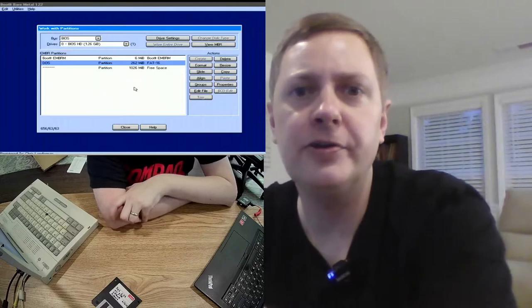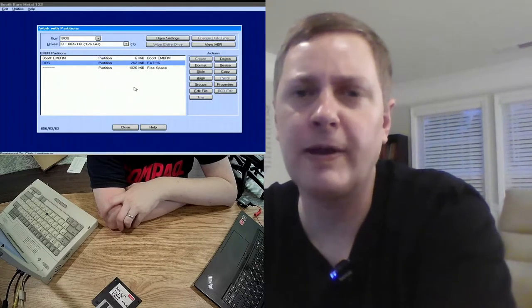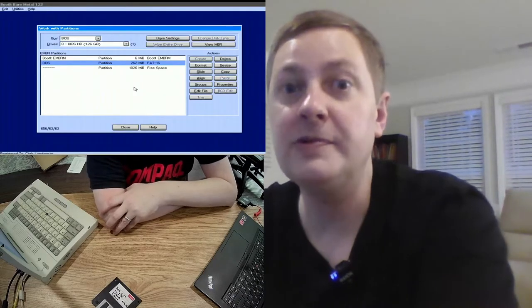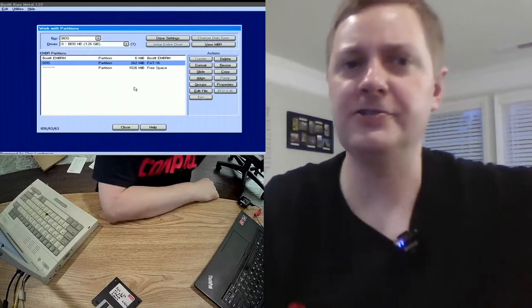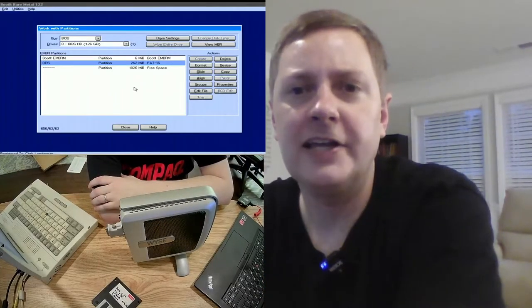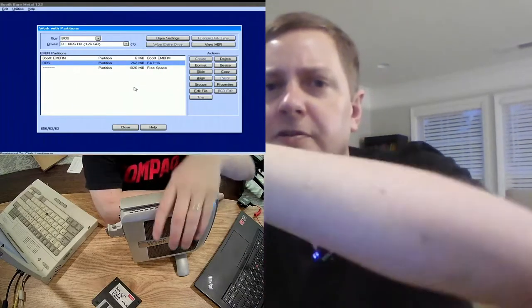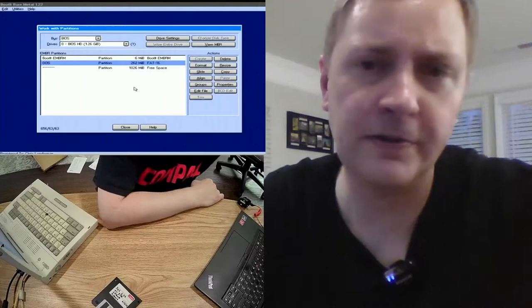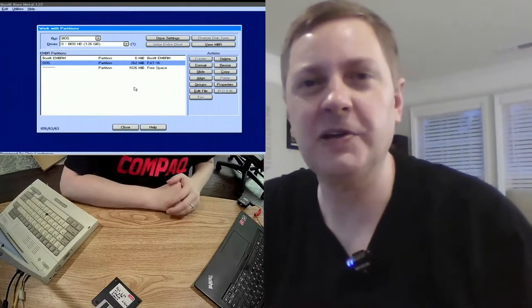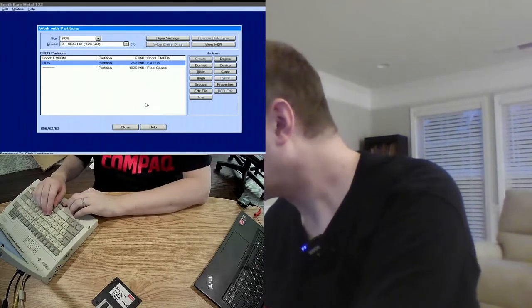But I needed to do a FAT32 partition, so I actually installed Microsoft LAN Manager using a VIA Rhine 2, since that's what the little Wyse dude had in him, and take that and then make a Windows 95 boot disk as opposed to, say, a DOS 6.22. And then from there, I was able to use FAT32 when I installed Windows 98. So it's actually what I was working on right before the live stream, capturing the procedure for that.